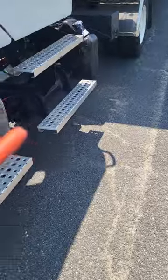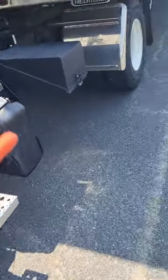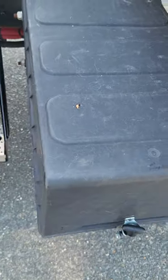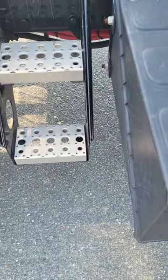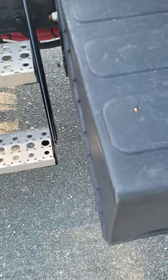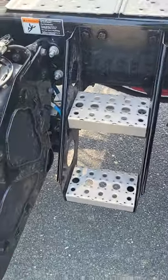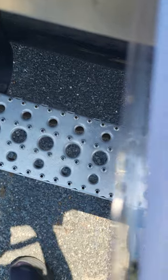Next up is the battery and battery box. On our truck the battery is accessible, so we unlatch it and open it up. Looking inside: my battery box and batteries are not bent, broken, cracked, or missing nuts, bolts, or screws. I see no signs of corrosion, and there's no electrical damage or exposed wires. Batteries — done, marked off the list.